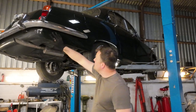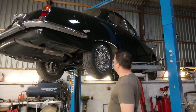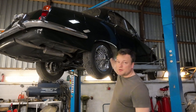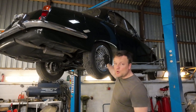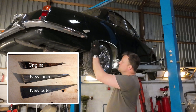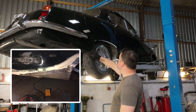This lower wing here I had to fabricate a new one and put it in. Unlike a modern car, all of the wheel arches are steel — there's no plastic barrier like you get on a modern car that actually protects the bodywork from stone chipping, which lets in water and causes rust. So this is basically an outer wing, then you've got a steel inner as well, and the two come together and were spot welded along this flange here. I had to replace both inside and outside and weld it all together.